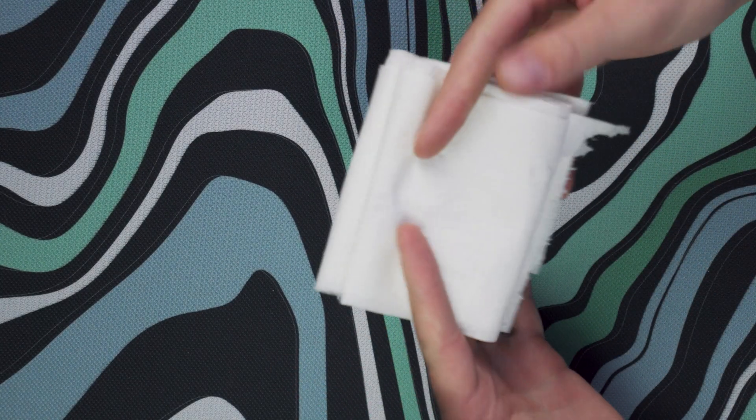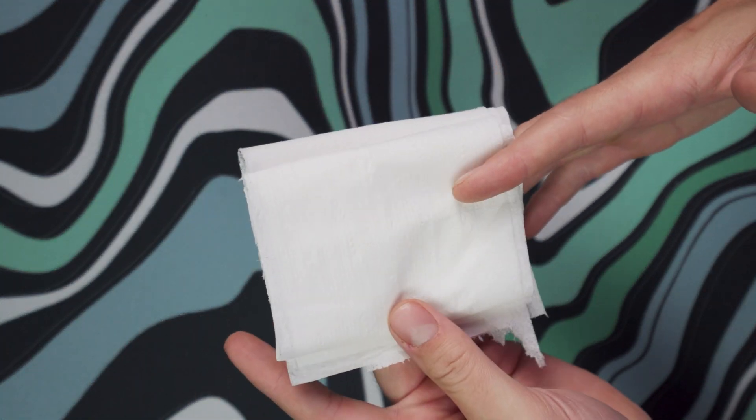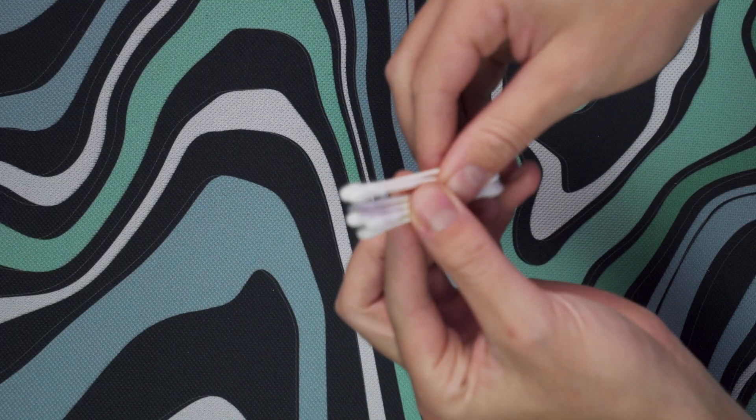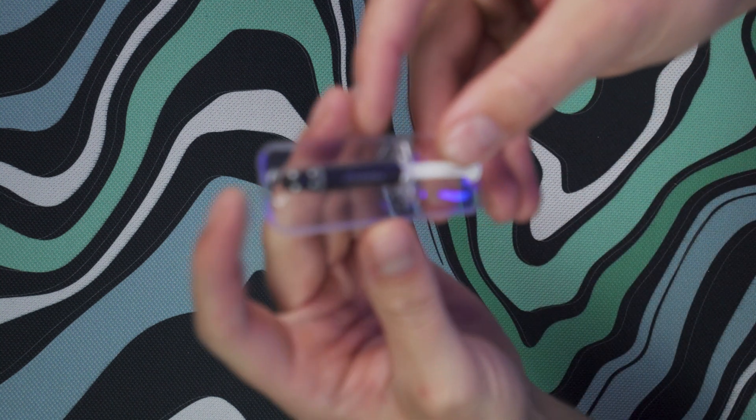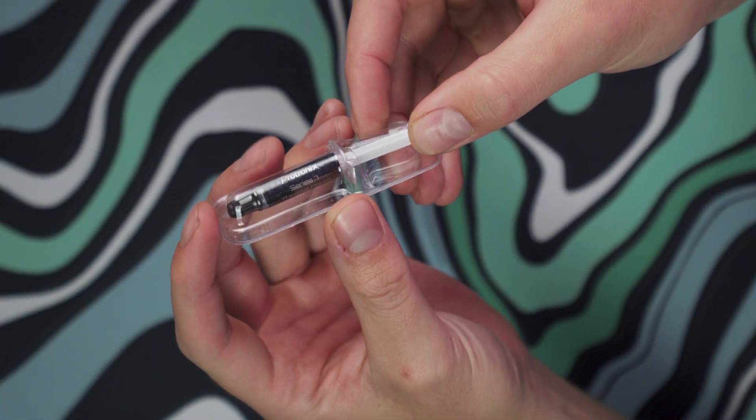Next you're going to need something to wipe off the excess thermal grease, and I'm just going to use some single-ply toilet paper. You can use something stiffer like a coffee filter — that's usually what's suggested — but I'm very comfortable with just folding up regular toilet paper because I've done it a million times. Next I'm going to be using a few q-tips, because there are some small nooks and crannies on the GPU and the shroud that q-tips work perfectly for. And of course we're going to be replacing the thermal paste on the die, so grab yourself some thermal paste and apply it properly — I'll show you that in a minute.